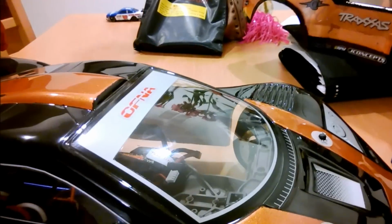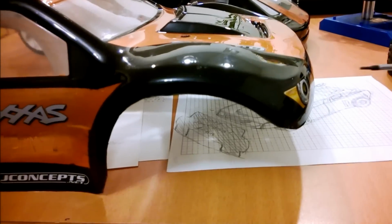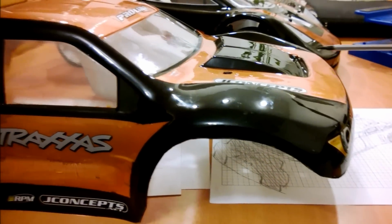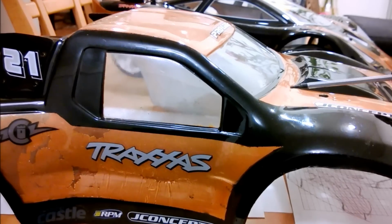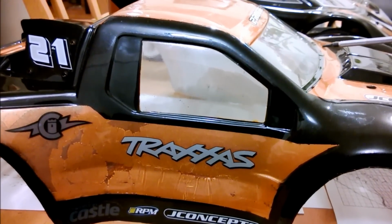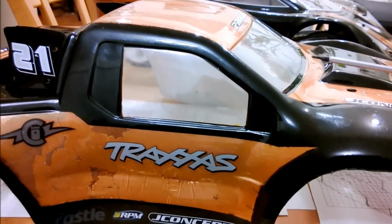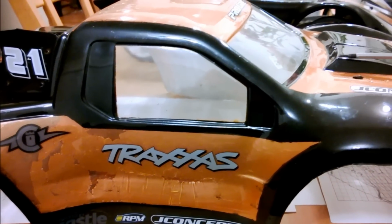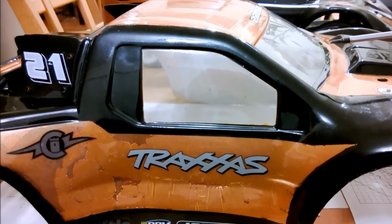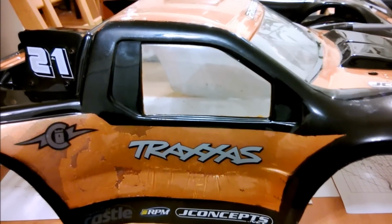By contrast, if you look at this truck body, and this is not a really bad aerodynamic shape, but you have a lot of blunt surfaces here. So the air is going to hit this, and then it has to turn this corner, and it's coming up here, and then there's a sudden drop off here. That's actually going to cause tumble. Tumbling air basically makes a little pocket that air can now flow over, but it disrupts the streamlines going through, and it causes a little bit of drag.